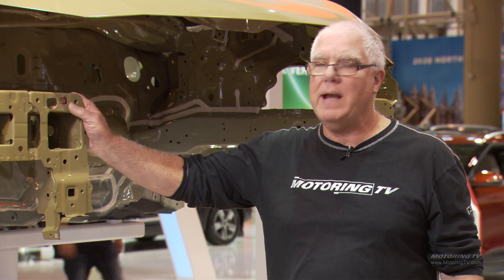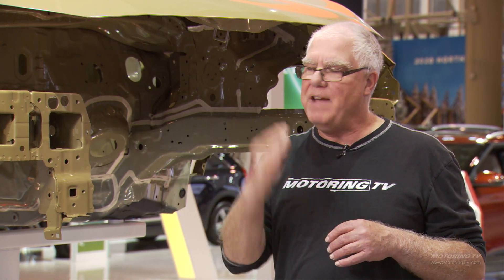Keep in mind that as great as this E coating process is, it's a factory process — you can't replicate it in the field. So what that tells you is if you get minor damage on your vehicle, by far and away the best process to repair it is what they call paintless dent removal. These guys are really creative — they can massage out damage to the panels of the car.